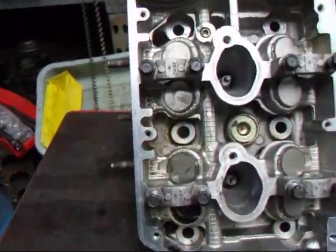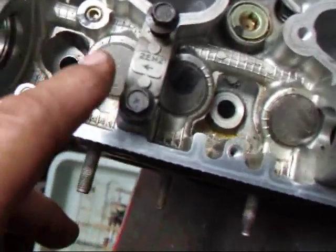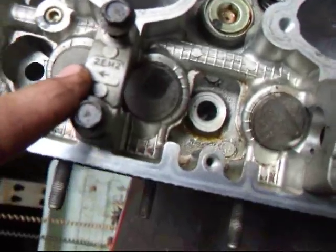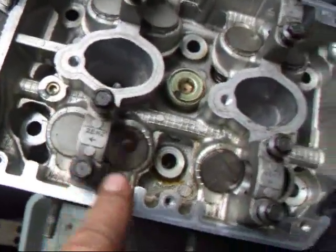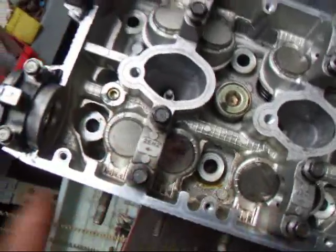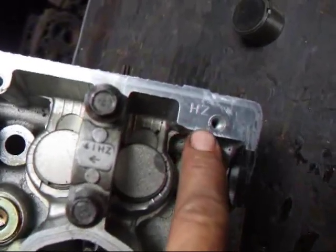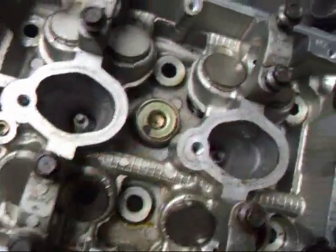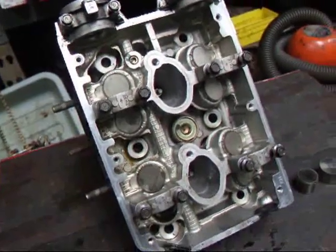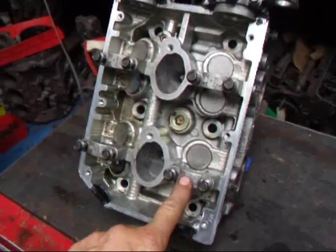When taking these Subarus apart, you have to remove the cams from the head to get the head off the engine. Make sure you look at the little numbers on the cam caps. This one says 2-E-H-Z and this one says 2-I-H-Z, meaning one row of caps is on the intake side and the other on the exhaust side. There's also a little arrow that needs to face forward. The caps match a head by sharing the same letters — H-Z in this case — which may appear in different locations on the head. This is especially important if you're getting a head of unknown origin from a boneyard.